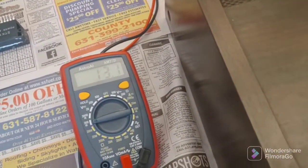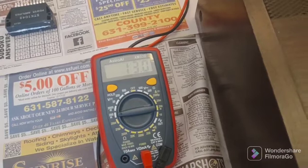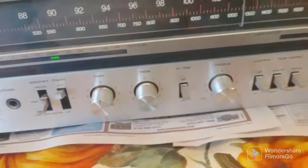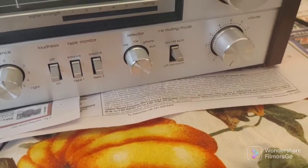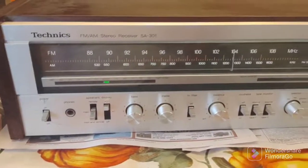That's how you change those output devices. There is a procedure in the service manual too, but I did it my way — whatever you're comfortable with, as long as the outcome is the same. Here are the old ones — they're shot. That's what was wrong with this unit. Before I put this back in the room it was being used in, I'm going to squirt some DeoxIT into this potentiometer because it's a little scratchy. The rest of the switches are okay. Thanks for watching everyone — bye bye, see you next time.